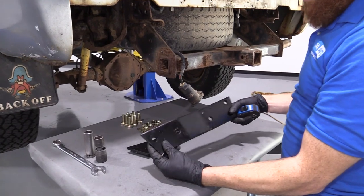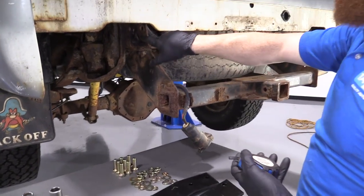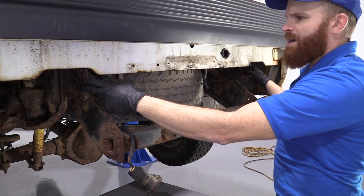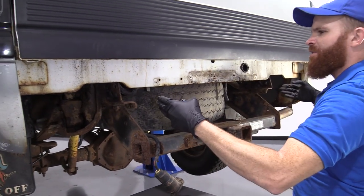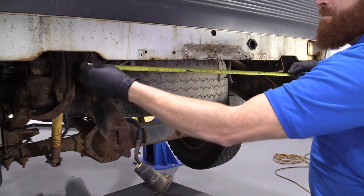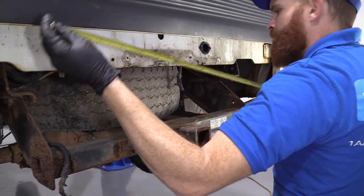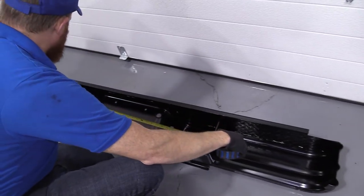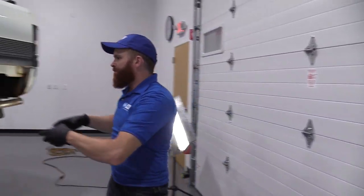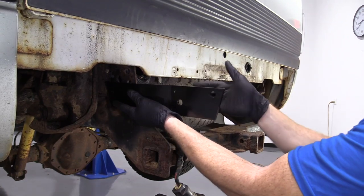So we have our bumper brackets here. As you can tell, they're a little squiggly — they're not a straight shot, which tells me that either the frame between here and here, or the bumper mounting area, is wider than one another. We need to find out if the frame is wider than the mounting area for the bumper, or the bumper area is wider than the mounting area on the frame. Something as simple as a measuring tape — we're measuring to the outside because that's where those brackets are going to go. We're looking at 37 and three quarters right here, and this is much thinner. So that means when we put those brackets on, we need them to come in.